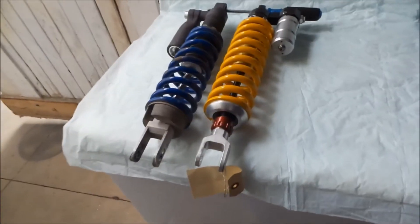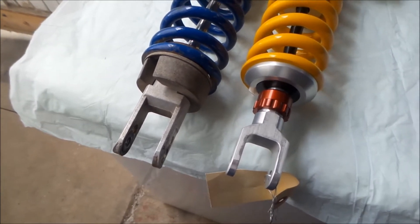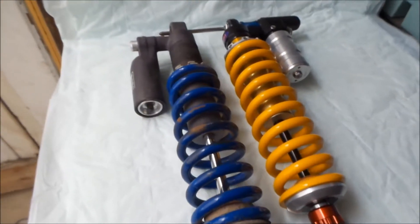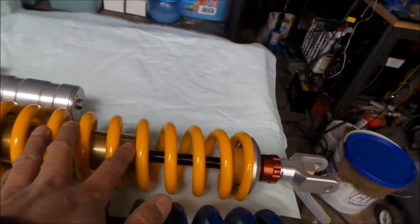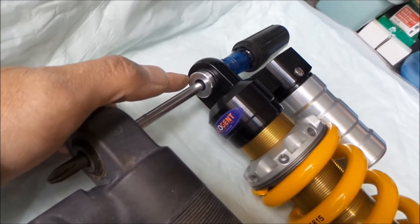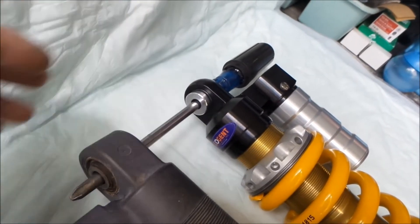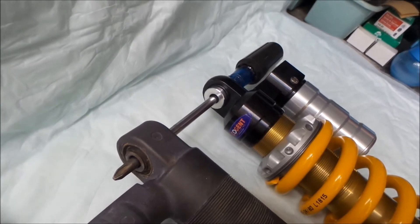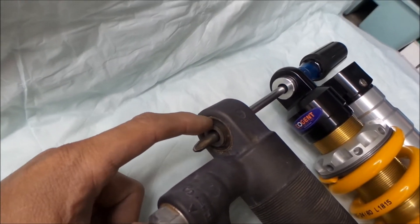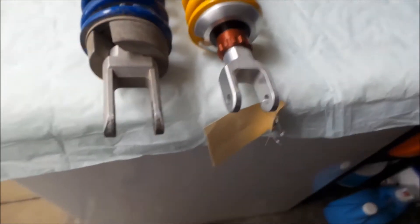Using a piece of wood lined up with the center of the bolt hole, you can see it lines up just below the upper bolt hole. I would have liked adjustability like this on the stock shock too, but hey — it's a custom shock built to my specifications. Another difference between the Mojave Pro and the stock shock is the upper bushings: the Mojave Pro has solid upper bushings, giving a lot less twisting and bending.